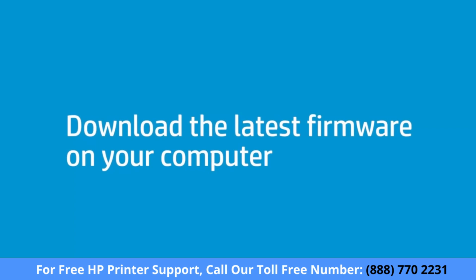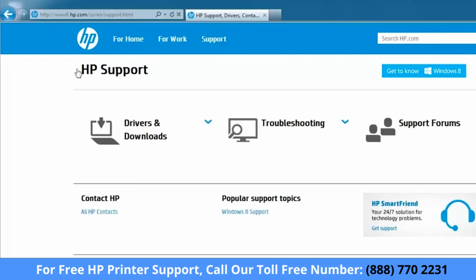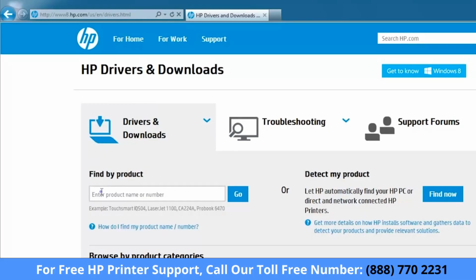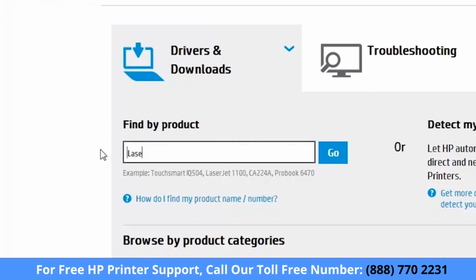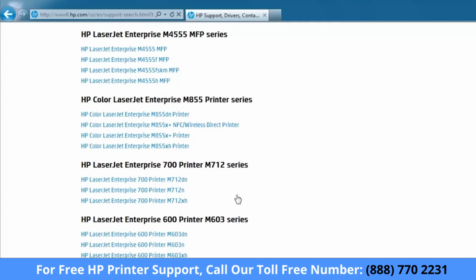Next, download the firmware from the HP support website and save it on your computer. Go to www.hp.com/go/support. Click Drivers and Downloads. Type the HP LaserJet Enterprise printer name or number in the search box and click Go. Select the model from the list of search results.